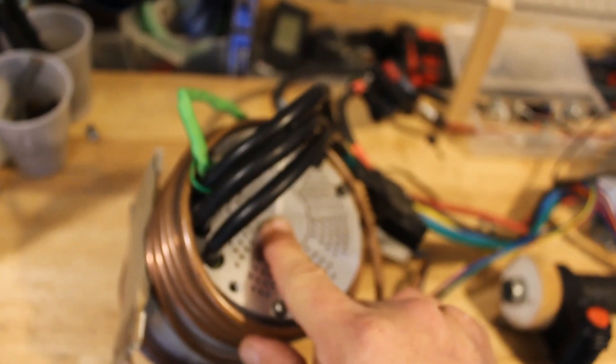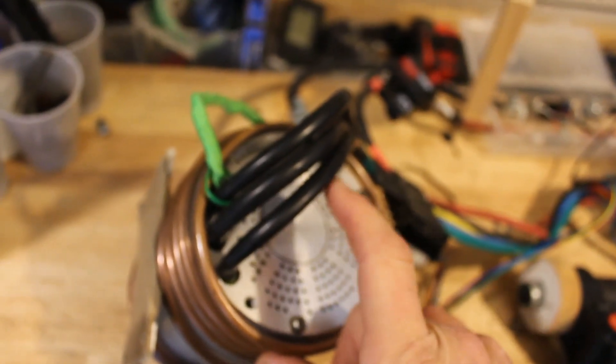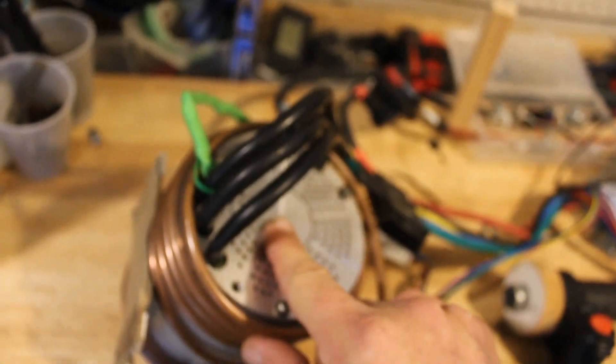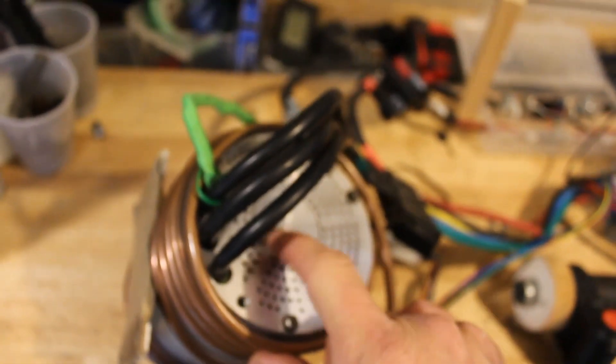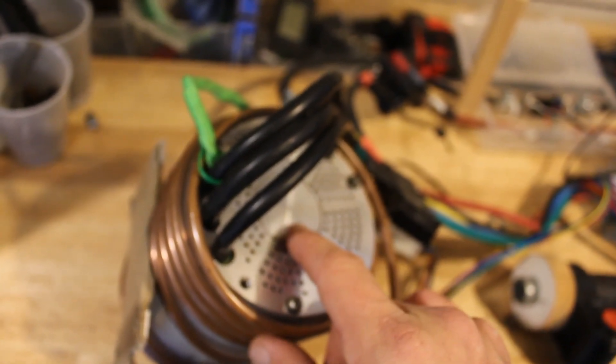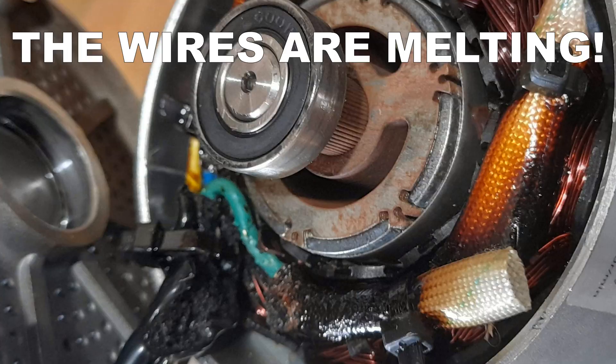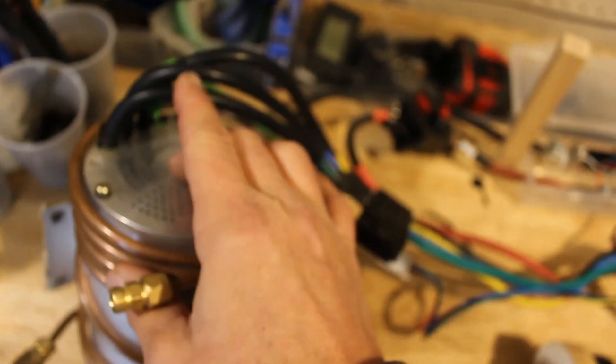I had to do a few modifications when I first got it. I changed these wires because the wires that came on this motor were pretty undersized. The first time I took it out for an extended run, they started melting. So definitely with much current going through, you need some thick wires — so I thickened these ones.